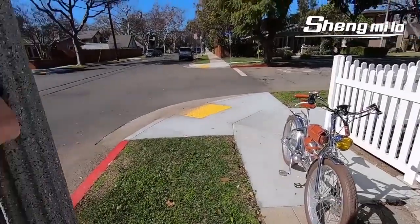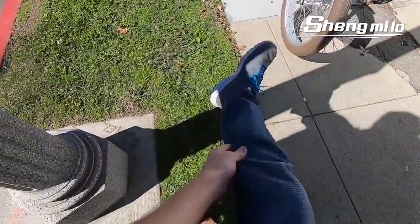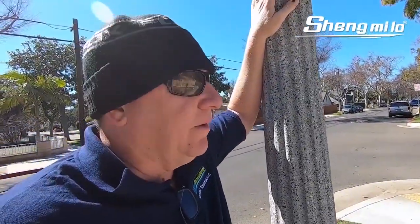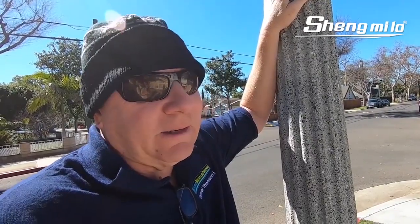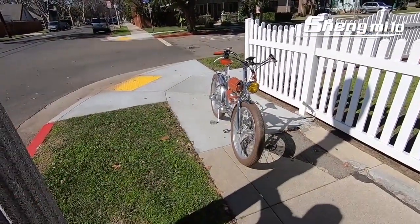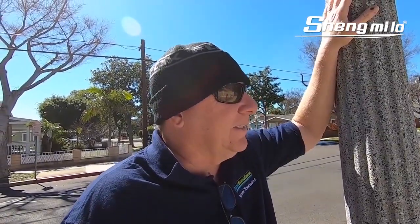It's definitely stylish. On riding with the shaft drive — for Sam it's kind of unnecessary, except that it's not going to snag pants, it adds a little bit of weight, but it's more reliable and lower maintenance. You don't have to worry about getting greasy, lubing a chain, or adjusting a derailleur. There aren't many electric bikes out there with a shaft drive, so if that's what you're looking for this is one to consider. It's a unique setup — and the polished stainless steel frame looks really cool.